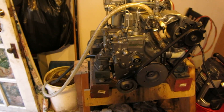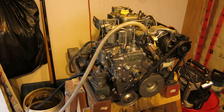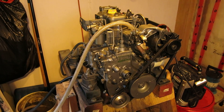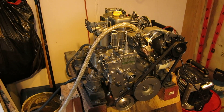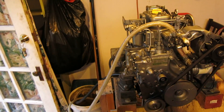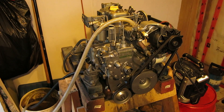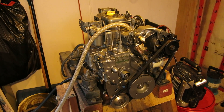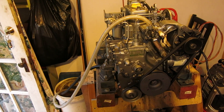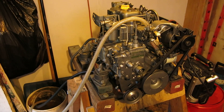It blew oil all over everything. We picked it up for a thousand bucks and did some troubleshooting - thought it's probably blown piston rings, just acting like a compressor, basically pressuring up the crankcase. We pulled it apart and that's what we found: the rings were shot, there was some scoring on the sleeves, and actually one of the pistons was cracked. We didn't know that - it actually ran well; it would take about 15 minutes before it would pressure up.